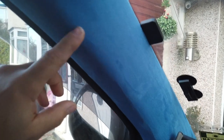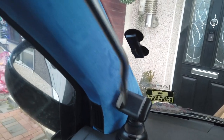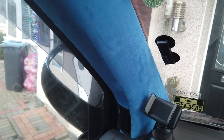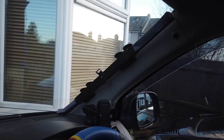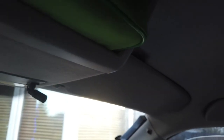As I've taken this one off before, these are held on by like three clips — two and there'll be one down there. We'll need a pry tool like this pry bar. Just get it in behind, ease it out and it'll pop out. There are wires running down here, so be careful not to pinch any wires when you're pulling them off. Same again there. So we'll get them off first and then we'll get the visors off. We'll do the back ones at the end.